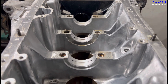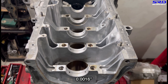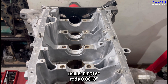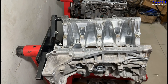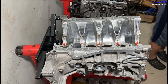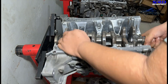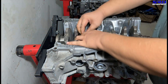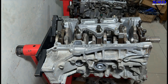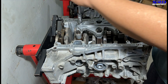We shot for 0.0016 inch clearance on the mains and 0.0018 on the ACL rod bearings. Now we wipe the main bearing surfaces clean, free from dust, then apply assembly lube. Remember: thrust washer groove side out, always. Apply assembly lube again, then seat the mains. Everything is hand-tightened and snug, ready for step one of the torque sequence.